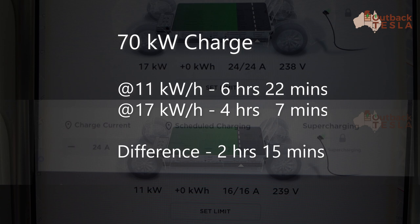The UMC at 11 kilowatts would take about 6 hours and 22 minutes charging, whereas with the Juice Booster 2 at 17 kilowatts it's about 4 hours and 7 minutes — which matches our normal daytime charging stop of about 4 hours. The Juice Booster 2 saves about 2 hours and 15 minutes on those daytime stops. That's a charge that lets us do about 300–350 km in the morning, 4 hours charging, then another 300–400 km — a full day's driving. Without the Juice Booster 2, that sort of itinerary wouldn't really be possible if we don't want to drive at night.